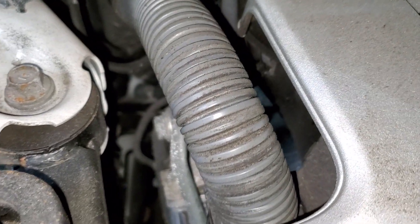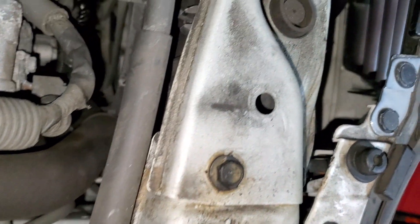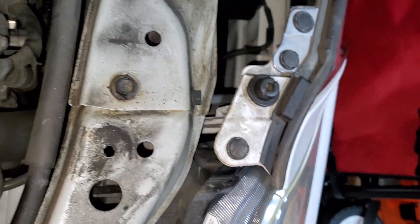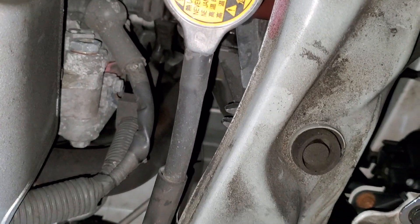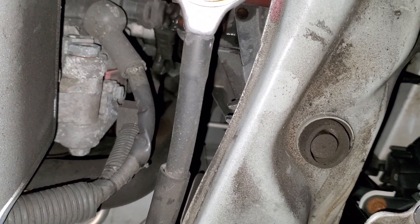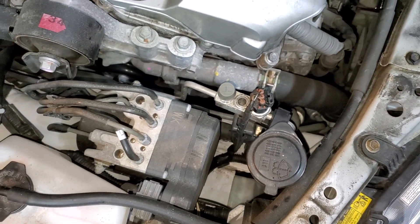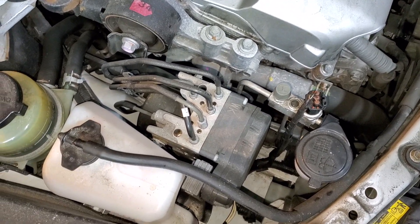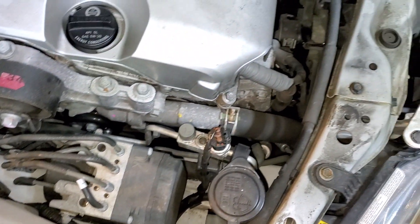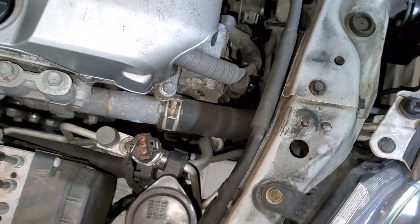Here is an excellent way of checking if your pump is leaking - look for clues. Here is a better view: you can see the residue from the belt right there. When the coolant gets on the spinning belt it gets thrown somewhere else, and now we can see it on the radiator and on the hose right there - you can see the wet spot. That's how you diagnose your coolant leaking problem: always look for visual signs.